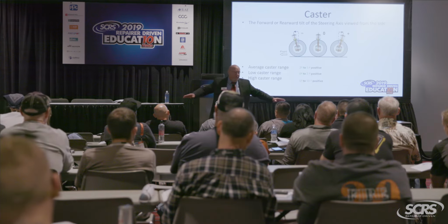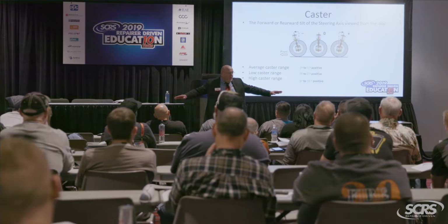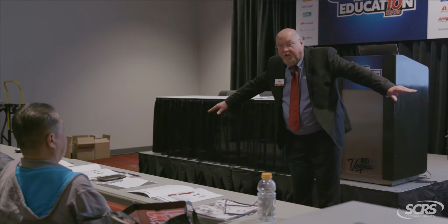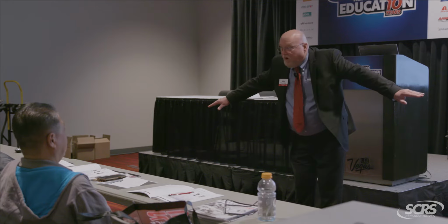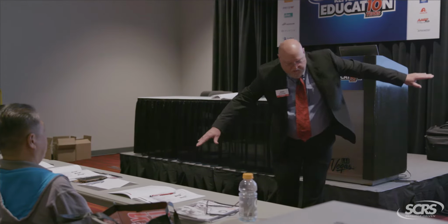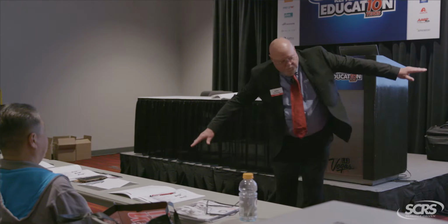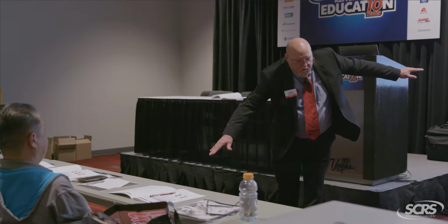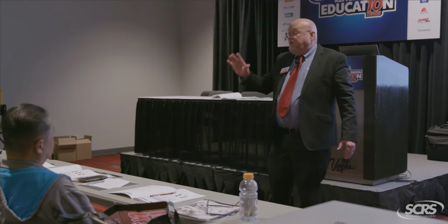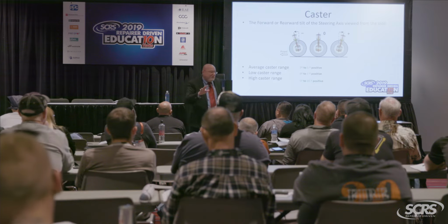Off-road equipment, yeah, all day long 0 caster. You're not driving that stuff over 20 miles an hour. Now, the older stuff has negative caster. Boom, a forward tilt. I've got a '67 Camaro, right? That thing is pretty wild to drive. Now, when I make a left-hand turn, look what happens to my arms. Right-hand turn, look what happens to my arms. Okay, back to center point. Let's make a left again. Where's all my force and weight at, guys? It's underneath my right, lifting and making that car easy to steer, which is good because my '67 Camaro does not have power steering. Doesn't have it, doesn't need it.